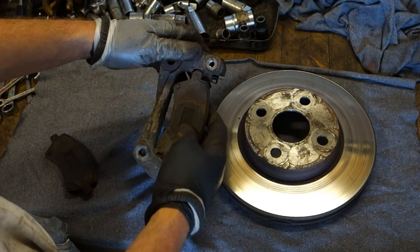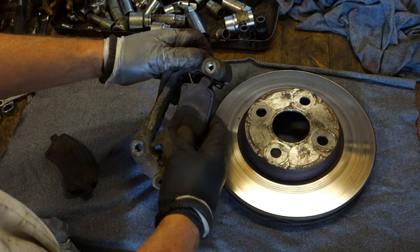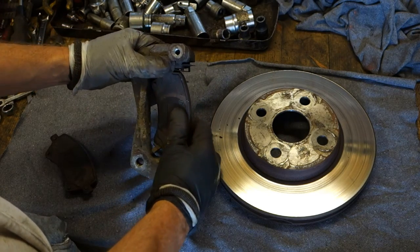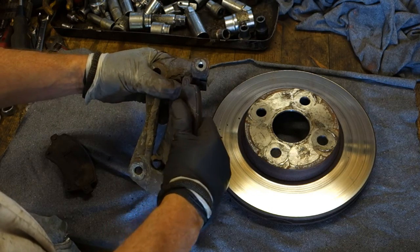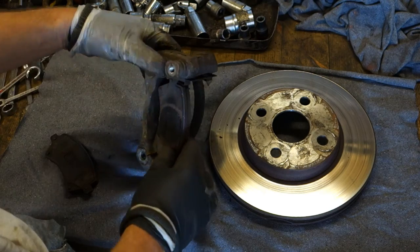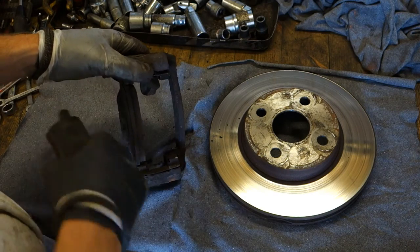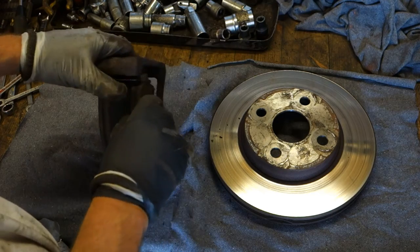It's so easy. And then we check how these brake pads are working, and they go in this joint and these holder places, and the idea is to check that these pads are moving nicely, because they should move quite freely. And now there is quite a little bit of friction, and I need to insert this lubricant in there. And the key is that these parts must move quite easily with this lubricant, and if they are stuck, then our brakes are stuck.